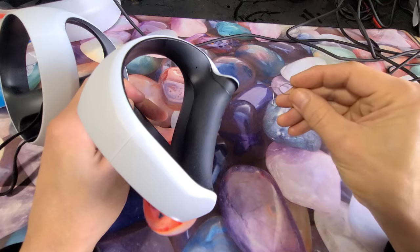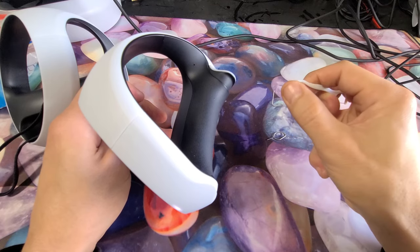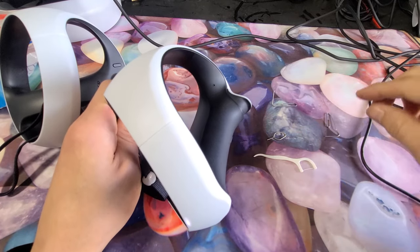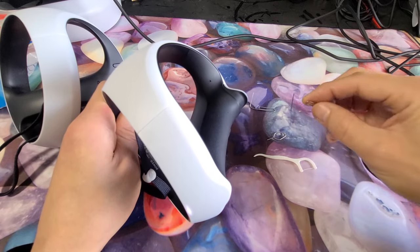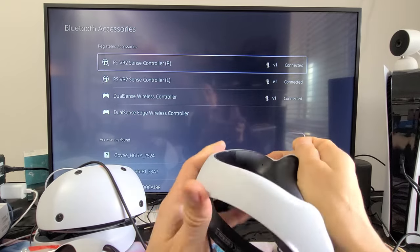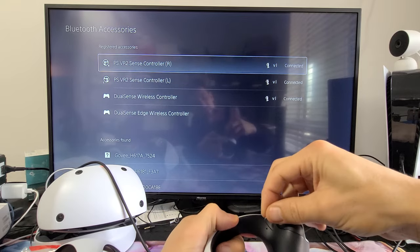You need to stick a small needle that fits in that hole. I tried a SIM ejection tool — it worked but I really had to pry it in. A toothpick worked best, except I broke the tip off. You can also use a paper clip, though you may need a slightly thinner one. Insert the needle into the hole — you should feel a little spring. Press and hold until you see something on the TV saying it's disconnected.